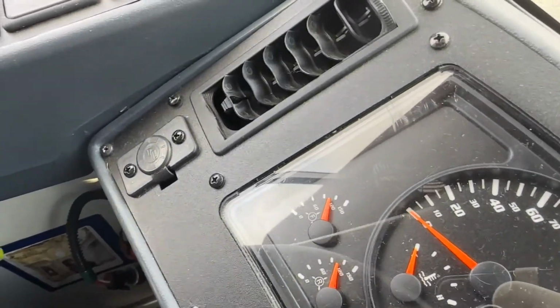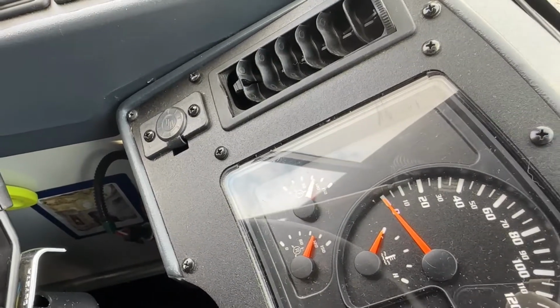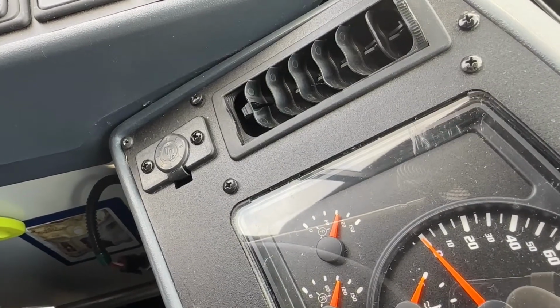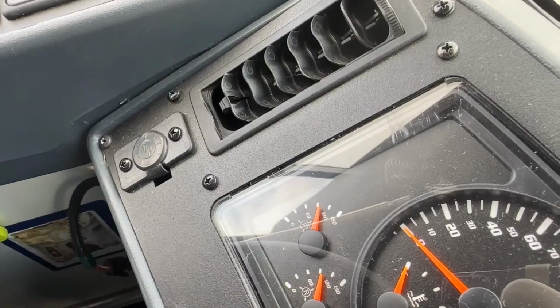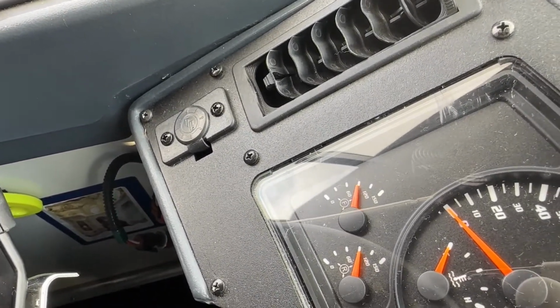Okay? After they tell you to move on, press in the service brake. After the initial drop, the air tanks will not lose more than 3 psi in a minute. Once again, you'll ask your tester if they want to time that. When they say move on, continue fanning the brakes.